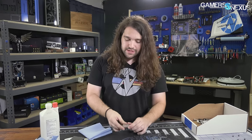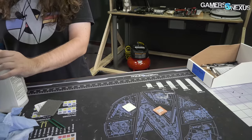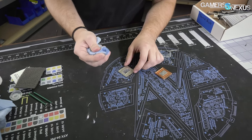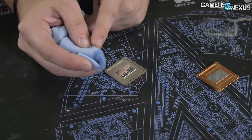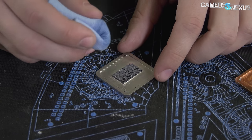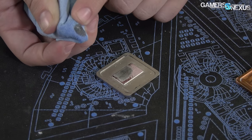Let's start with the nickel-plated copper IHS, because this is the most standard thing you're cleaning off, other than silicon itself. You shouldn't really ever have to reapply liquid metal, but if for some reason you do — maybe you switch systems and remove it — you can just take something like the blue shop towel. We like it because it's a little more structurally sound than standard white paper towel from a food store. Put some rubbing alcohol on it, and that'll kill a lot of it immediately.